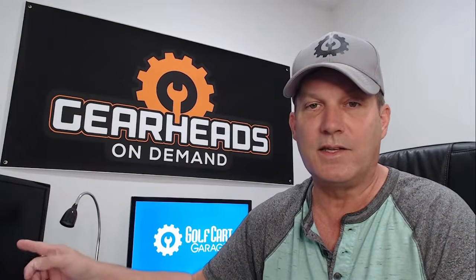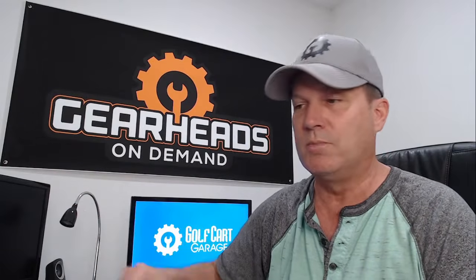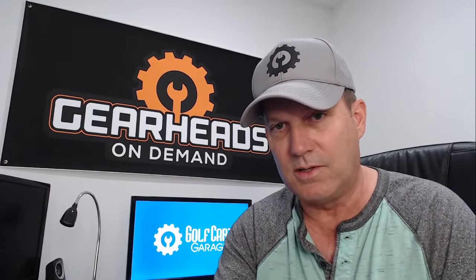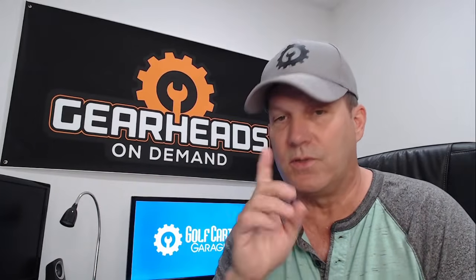Make sure your outlet has not tripped a circuit breaker or something, wherever the circuit breaker is for that charger, because it would do the same thing if that charger had no electricity. You plugged it into your cart, there would be a slight delay, and then the relay would click, but the needle wouldn't move. So that's one thing I would check.